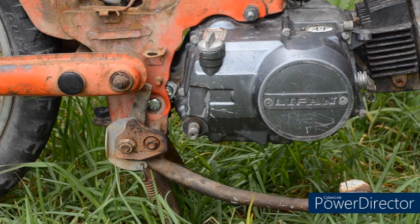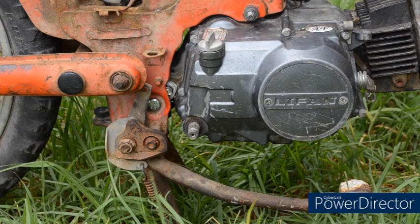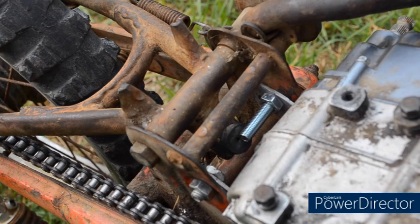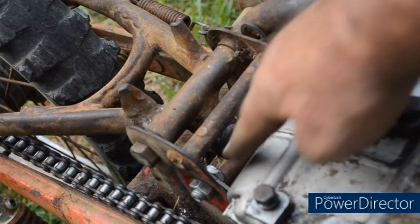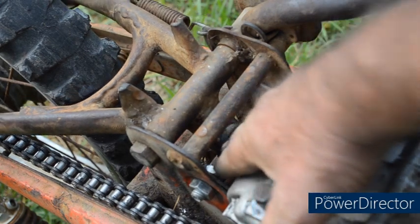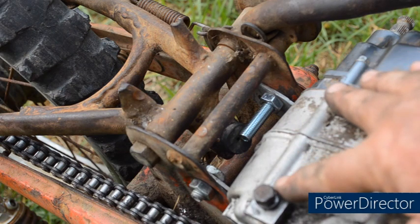It doesn't look really good, but that's as close as I can get it. I'll turn the bike upside down and show you what I've done to make a rear engine mount. Well, the engine is in and it's absolutely rock solid. I made the brackets out of aluminium simply because it's easier, just to prove that this works — and it does work. Now what I'll do is make some brackets out of steel, with an M10 bolt through there and a spacer through the centre. The spacer will also do the job of holding the centre stand down slightly, and I think that's a much better idea than the straps across. You've got open access to mount your footrests.